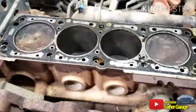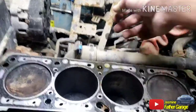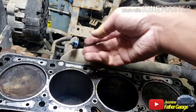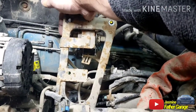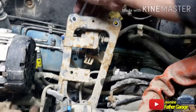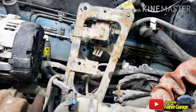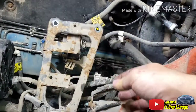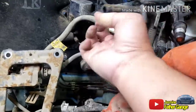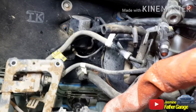Back here. Yeah, the only thing that needs to come out back is a coolant sensor. The bolts bolt to the back of the intake. I took this off. I thought it would come together. The evap. No, I took the evap hose. I guess you don't need that. So the only thing that connects to the engine is this and the heater core hose. This stuff. Okay? Only 3 things connect to the back of the engine.